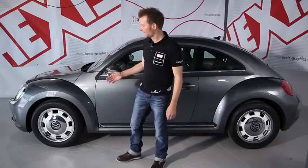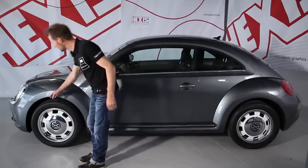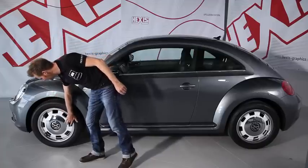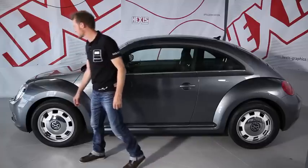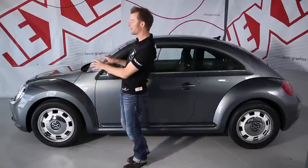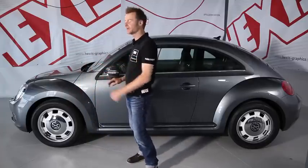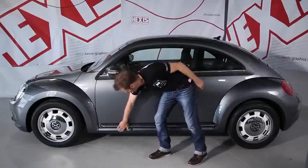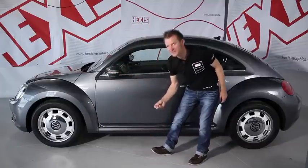You have to be careful with the details and look, for example, at the tires, which accumulate dirt, and the same for the wheels. It would be good to cover them with paper before you start with the wrap, in addition to the basic clean. Then, the rocker panels are often heavily soiled and coated with sealant for protection. That obviously has to be cleaned.